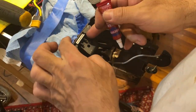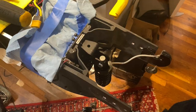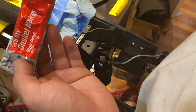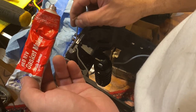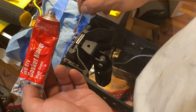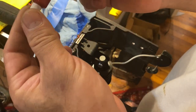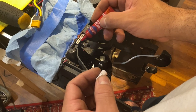For this part we're going to use red thread locker. From the inner part, to prevent any water from coming inside through the threads, we simply add a little bit of gasket maker to make sure it's sealed permanently — it won't be leaking through it at all. Where the nuts go, even though they have nylon heads, we're going to use red thread locker — one drop in each.